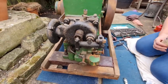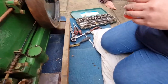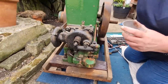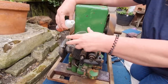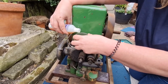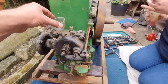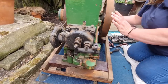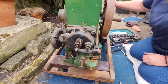Okay. Right, get that bottle off the table behind you. I'll put some red diesel in there. And there should be a little funnel down there somewhere I set out for you. Can't see one. There it is, behind the oil can. Put that in the plug hole. And then put a bit of that in there. That might start to come out the valves, no doubt. How much? Keep going. Yep. Right, now you want to turn that engine over again by hand. What, using the flywheel? Yeah. And hopefully that diesel will now lubricate the cylinder.